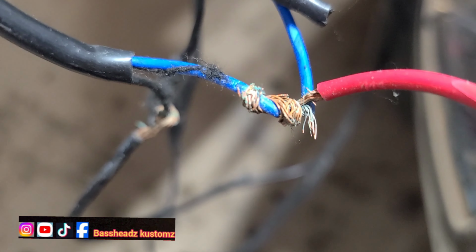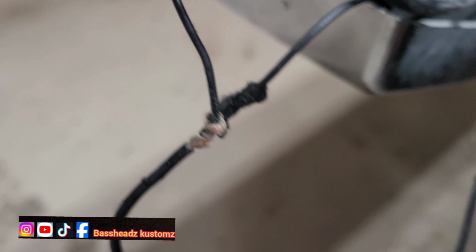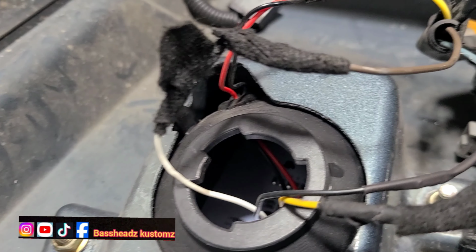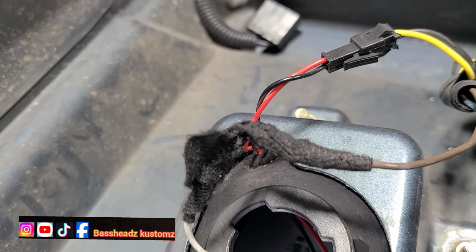Okay, guys, I done broke these wires down and got almost to the root of the beginning. See that? Just wrapped wires. Y'all see the corrosion on there? These wires are just wrapped, stuff just popping off. He spliced in the stuff. The ground goes to one splice, another splice, another splice. He's just splicing all over the place. And I know there's no solder or nothing in there. So I'm gonna just probably cut that off. I'm not even gonna try to cut that tape off.